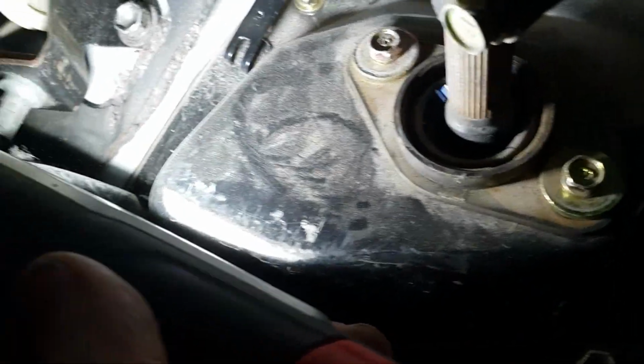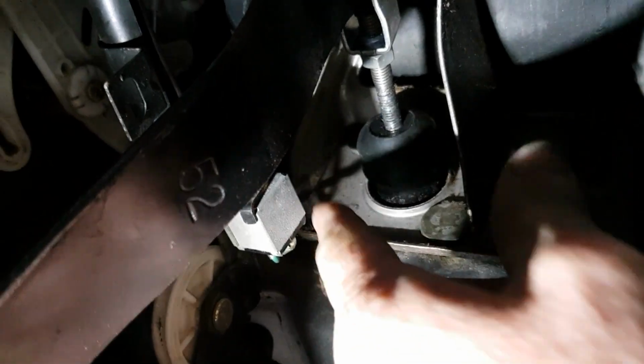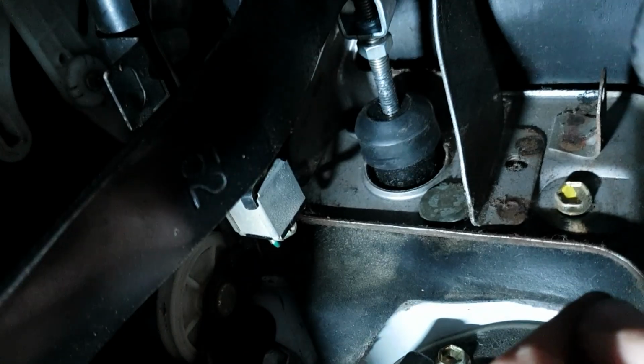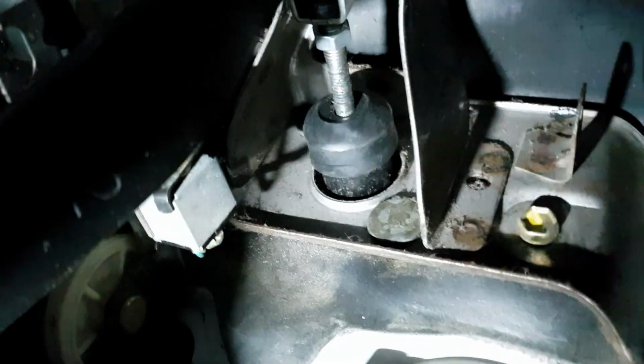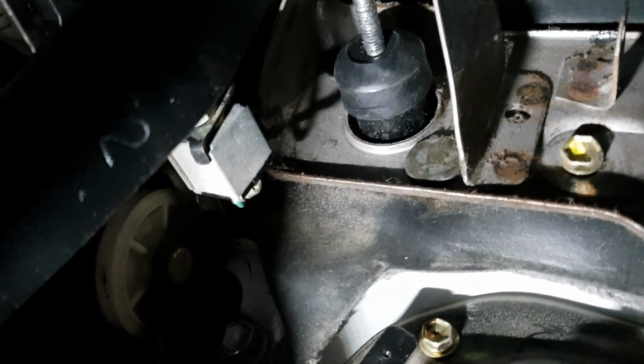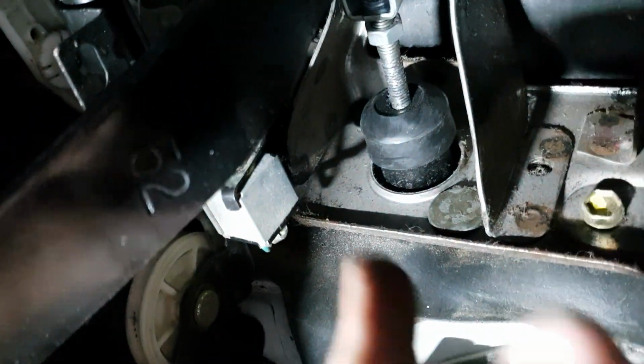So we look up here. Can we get it? So here's the adjustment. And I'm going to see if I can, oh, it's actually, the nut is actually loose. I haven't been in here yet. And it is wound up tight, so the push rod's actually permanently pushing into that master. And there's not much before it actually touches the lever.